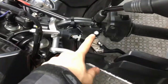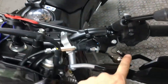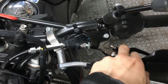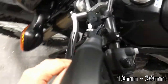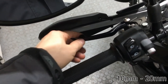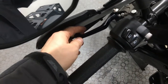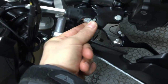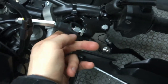With the pivot bolts torqued correctly, before putting the rubber protectors back on I need to ensure the clutch free play is appropriate. The manual states about 10 to 20 millimeters — meaning the lever should move freely that distance from the handlebars without putting any tension on the clutch cable. I've already set mine up and just need to tighten the adjuster a little more to secure it.